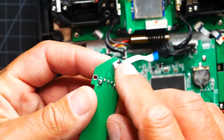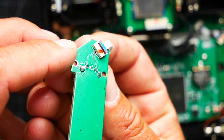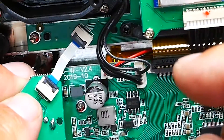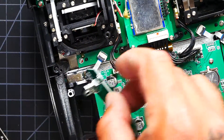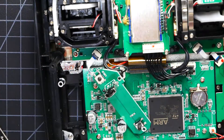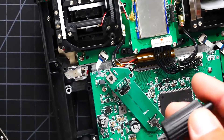You need to be very careful with these ribbon cable parts. You see that black little tab — that's nothing but a clip. All you do is peel that up, and once it's in the up position, the ribbon will slide out. Then all you've got to do is slide the new ribbon in there and lock the black clip back down — super simple. Give it a very gentle tug just to make sure you've installed it correctly. If you happen to purchase just the board and not the wheel, that's okay — just put your old wheel back in.